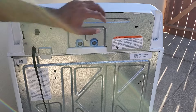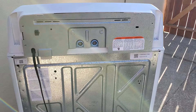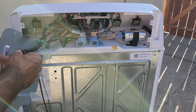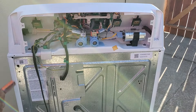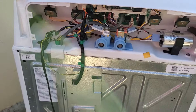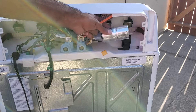There are six screws — one, two, three, four, five, and six — that hold the back cover right here. Once you've got those removed, go ahead and pull off this panel. It's okay if it dangles a little bit because this is just a diagnostic port for if a technician needs to look up error codes, and this is just a ground. After you remove those six screws, we're going to remove these two on the bottom as well. To get to that screw, you may have to move around the motor capacitor a little bit, and that's okay.